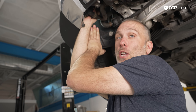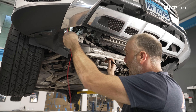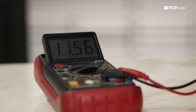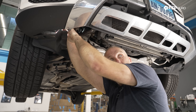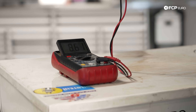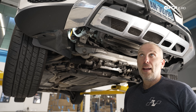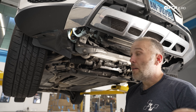I'm going to grab my multimeter. The first thing I'm going to check for is ground, which is the easiest thing to look for. I have the car powered on in accessory mode. Checking back to the subframe, we have 11.56 volts — that's going to be battery power, so the power wire is good. Now checking our signal wire, which is pin two — the thinnest wire of the three — according to my multimeter it's commanding 8.7 volts on the signal side. We've got good ground, good power, and we have a signal from the DME.